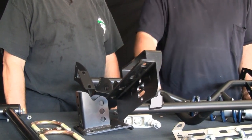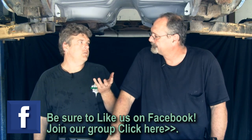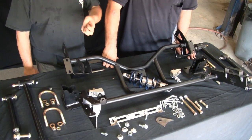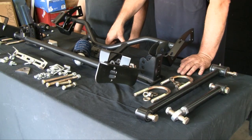A sway bar does create some exhaust clearance problems, and this system itself does create some exhaust clearance problems. We're not putting a sway bar on it — it's strictly for exhaust clearance because the car is not going to be doing a lot of road racing. The coilover system is going to be less needy of a rear sway bar for what he's doing with it. If it was going to be a track car, I'd want a sway bar, but most serious track cars don't have exhaust coming out the back anyway. So this is kind of a trick street car throwing some good options at it.